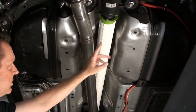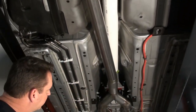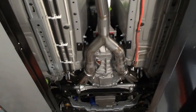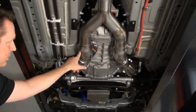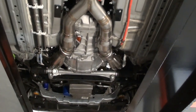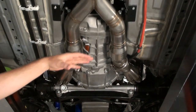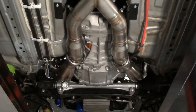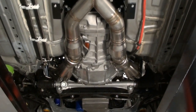We've mocked up a driveshaft — long story there, we're still waiting for that. We've got a three-inch exhaust pipe that runs all the way forward. There's a Y where they go from the two exhaust headers, so that was all handmade in-house. We got two Magnaflow catalytic converters and V-band clamps up front as well. Really good ground clearance — it's tucked up in the factory tunnel and should have a nice sound, quiet and not too obtrusive.